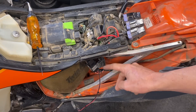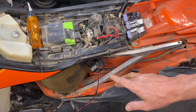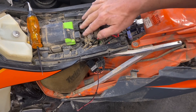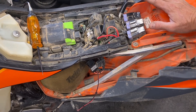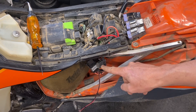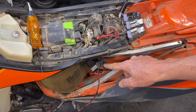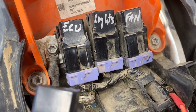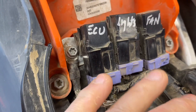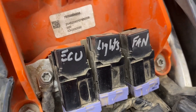Now that we've got our relay installed and our fuse accessible, we know it's going to be located in the airbox. Some guys will like to put it on top of the battery — there's a little nook where you can hide it. Just remember that you've got accessories connected to this fuse, so if they ever go dead, that's the fuse you're going to check and change. Make sure you not only remember it, but have it in an area that's accessible. It's also worth pointing out that the relays on your bike — on the 2020-plus models they're on top of the battery; on some earlier bikes they're underneath the battery or under the side panels.